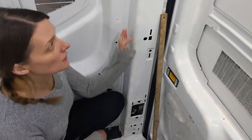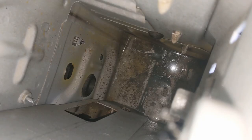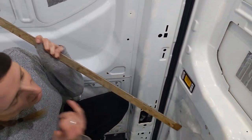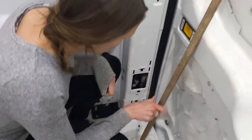Tim and I were just putting the insulation down this pillar and we looked down the bottom here and you can see some glinting. We put a yardstick down as a measure and it comes up to about there. It might indicate that there's a drain hole blocked somewhere. So we've got to go and investigate that — you don't want water in there.